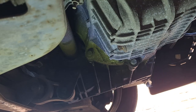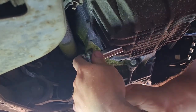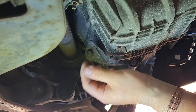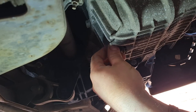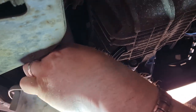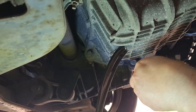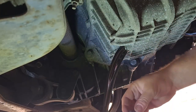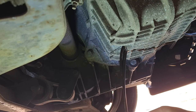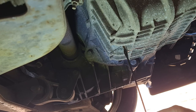That's our drain plug there - it is a 13mm nut. Ideally you'd want to change this drain plug but I haven't got one at the moment. Get that loose - and this is going to be hot, so I need to make sure I don't burn myself. Get your bowl ready. This is hot because I've had the engine running so it's going to be pretty runny, which is what you want because any sludge in the engine will come out with it. That is looking pretty black as you might expect, but there are no chunks in it, which is good. There's no milkiness or coolant or anything like that, so that is absolutely superb.